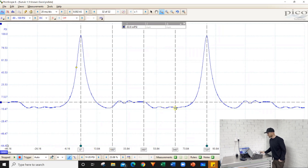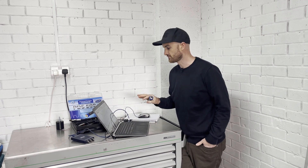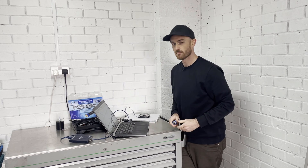The cylinder comes back down and we can see the pressure goes below the zero line — that's our intake manifold vacuum we're measuring there. Around here the valves will close and the pressure will increase in the cylinder. The key main points are: the compression peak should be equal on both sides; we've got exhaust valve opening and exhaust back pressure; the intake valve opens and as the cylinder draws down we see pressure reduce, indicating intake manifold vacuum; then the intake valve closes and the cylinder comes back up to top dead center creating our cylinder pressure. That's a basic introduction to in-cylinder pressure diagnostics — this sensor really impressed me, though I may look into getting something more powerful for better resolution.